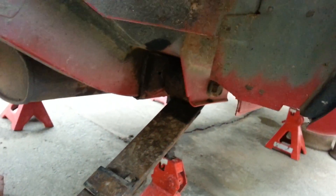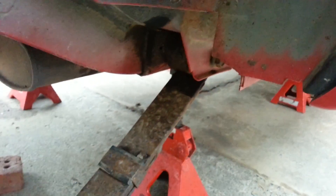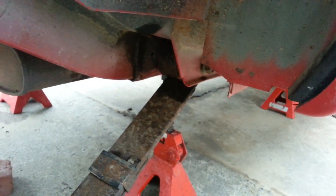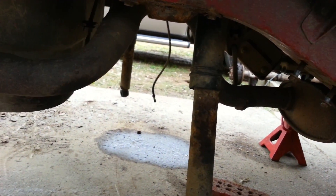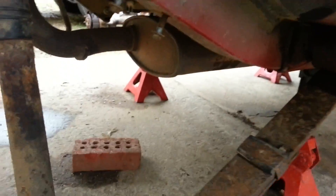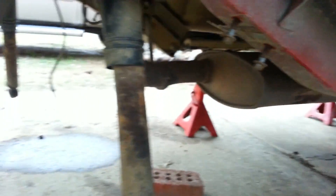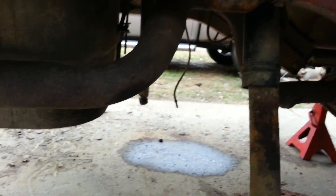The problem is the front has completely seized up — I can no longer turn it with the breaker bar, so I'm going to wait until tomorrow to work on that some more. Got the shocks disconnected, the emergency brake cables are disconnected, the brake lines are disconnected, and I obviously have the U-bolts off the axle.